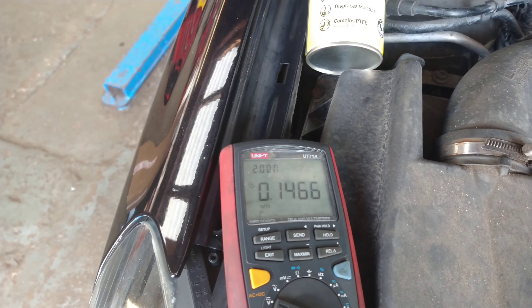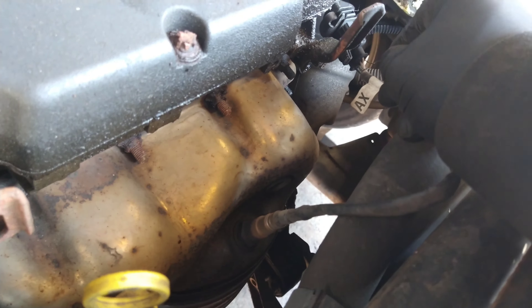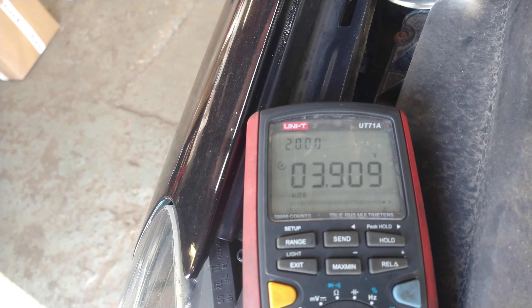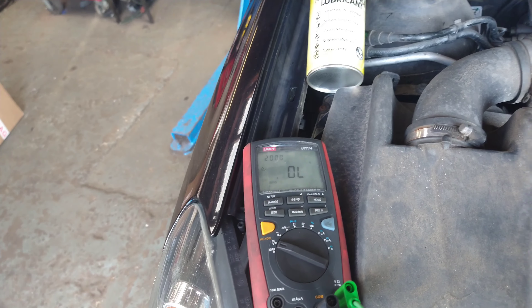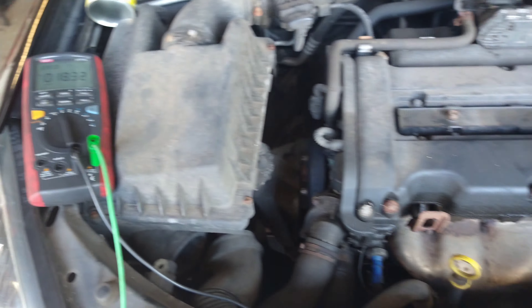Next I'm going to quickly check the heater. It's still stuck at 0.1. There are two white wires — they're both the heater. You can see from the bar graph it's being switched on and off and the reading isn't keeping up with it, so it's getting control and it's got the power — the heater side looks okay. Across the two white wires I got 18 ohms, so it's not an open circuit. I'm happy that's working and it's being controlled.